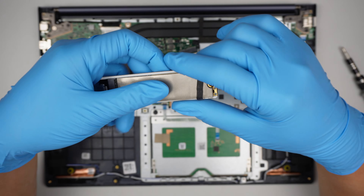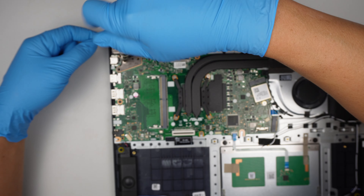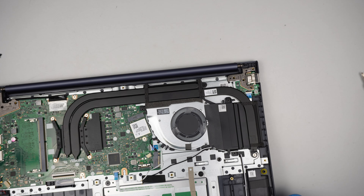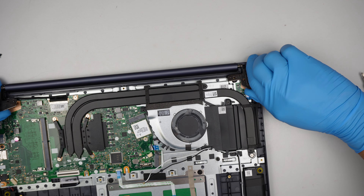Let's remove the screws on the top left hinge corner. The hinge holds down the motherboard as well as the LCD screen. There are three screws — one white and two black. Do the same on the right side and remove those screws as well. Then lift it up a little bit and push it all the way out. This is the LCD connector for your screen — slide it away from you, and the whole thing will just come right off.